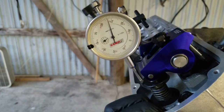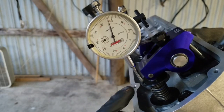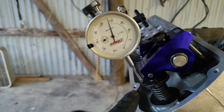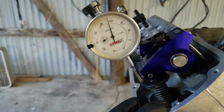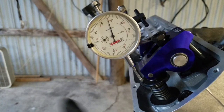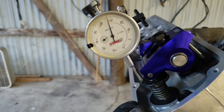That is our lift. Make sure that down here you're measuring off from a flat spot that's parallel with it, or else it's going to give you an inaccurate measurement — your retainer could throw it off if it's not perfectly flat. I've measured this a ton of times. I check and recheck all of my measurements and clearances because I want this thing to last, not have problems. I want it to be a good, solid, reliable foundation.